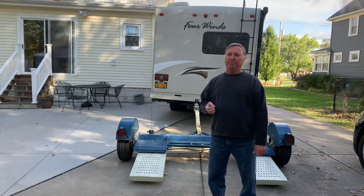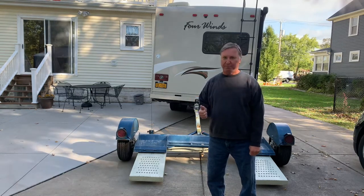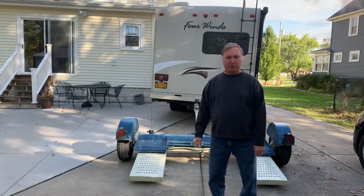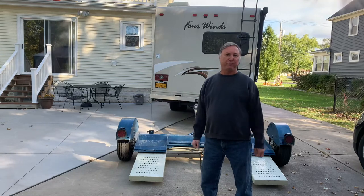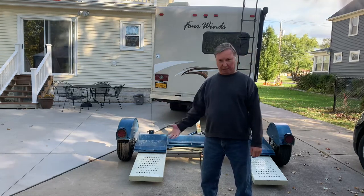It's a great feature to have; however, you can't back up. When the car is on here and you try to back up, those brakes will lock up on you. So if you stop at a store or something, make sure you can pull straight out again. I try to find sites that accommodate maybe 44 feet or 35 feet — just a little longer than what we have — so there's plenty of room for both the car and the tow dolly.